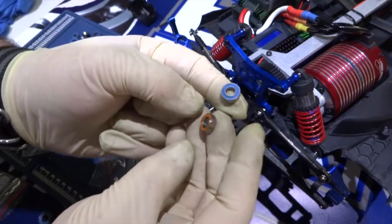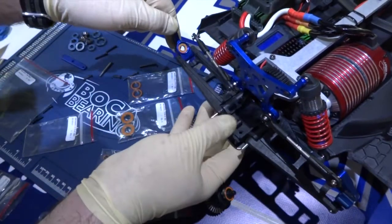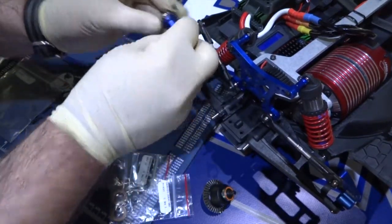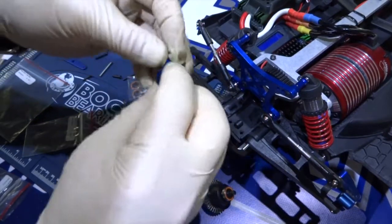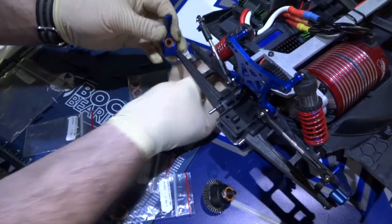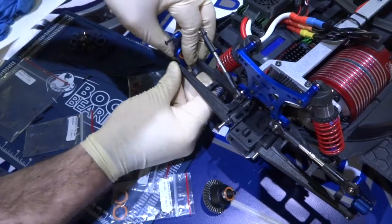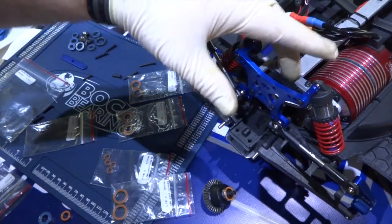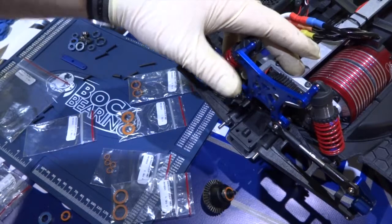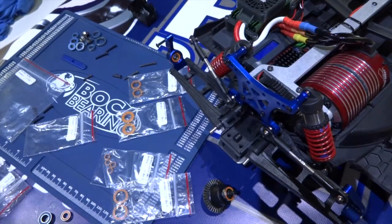We got the old one and new one. So, one goes on the inside here, like so. Flip that guy over, put one in there. Excellent, so just go ahead and take this guy and just go ahead and put him back on. One thing I want to mention is when we do the cush drive and the center drive train and the steering, that's when we'll take out the other bearing for the diff here. So that's one part that is going to get pushed into doing it when we do the center part.